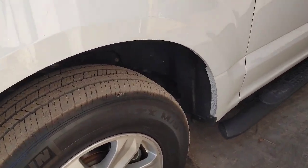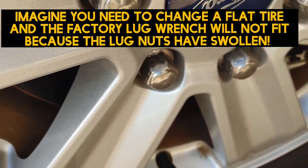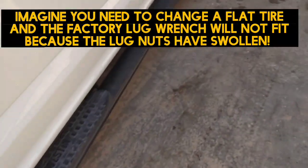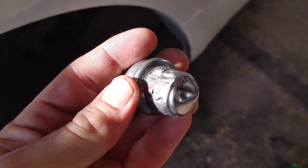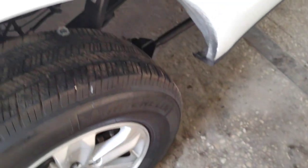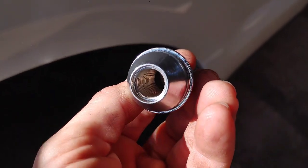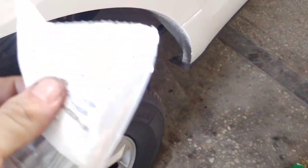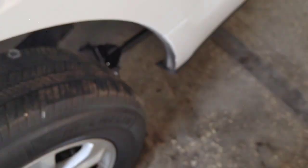The main problem with this truck was that the factory lug wrench would no longer fit these lug nuts — they'd swollen up and we kind of messed them up trying to find a socket that would fit properly. We got a few of them off but had some problems and had to beat some sockets on just to get them off. The replacement we're using is a Dorman brand — I'll show you the part number here — and they don't have the issue with swelling up.